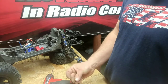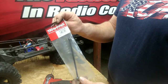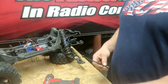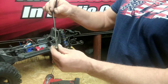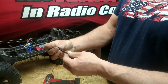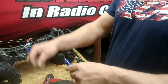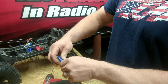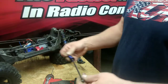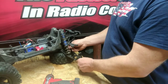We're going to take this center piece out because you're going to need it for the other axle — that's what that pin goes down through. The new drive axle is a 7750X. Take the old one — you can see, I don't know if you can see it on camera, but it's quite bent. You're going to take this center piece, put it right back through like so, line up those holes that we just had, take the pin and push it right back through, making sure it's going through the center. And voila — just like so, nice and easy, all back together.